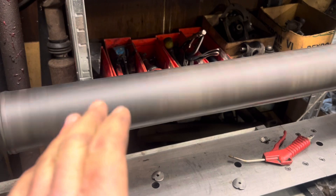It's down here — this U-joint articulates really hard, as I said. I've pre-run this and set it up for a balanced look. The factory weight is exactly at the bottom, and it's calling for additional weight here — that is not uncommon as vehicles age. It's exactly that: driveshafts change over time, components get stressed a little bit, and the balance package changes. The U-joint is very difficult to articulate. That's a Spicer Snap-Tite — a Toyota-spec Spicer Snap-Tite with a grease fitting, so it's a greasable Snap-Tite — yet it articulates really hard. Trucks tend to kill the U-joint at the rear axle first, because that's the one that's down on the slop. I have no idea what mileage is on this truck, but that's what I'm seeing.